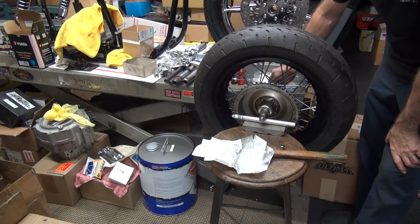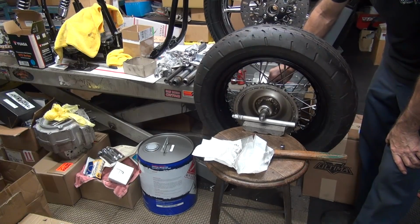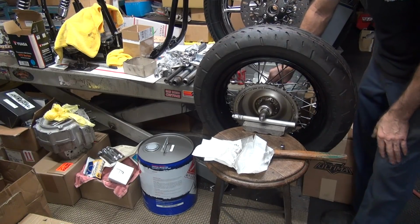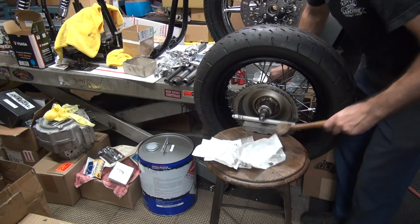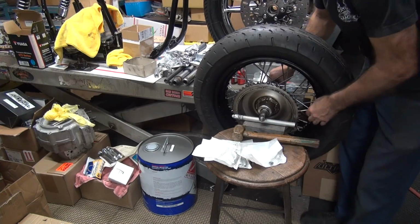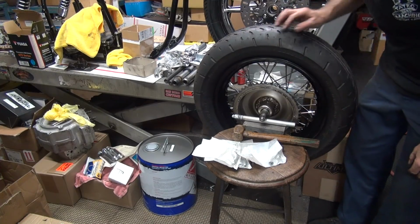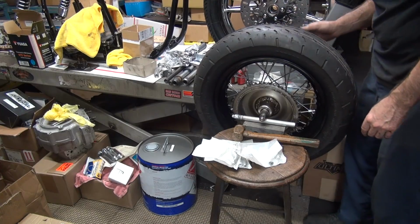See, the wheel's not really moving now. It's trying to go up a little bit, which means it's not heavy enough, but when you move it out to the outside of the nipple, it'll be heavier. Alright, we're 1/4 ounce. I'm going to get in there with this hammer. No. The brake drum makes it hard to get in here to do anything with. I'll have to come in there with a punch to get to it. That'll be kind of interesting to do.